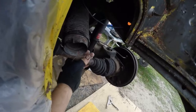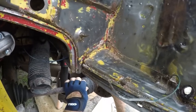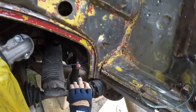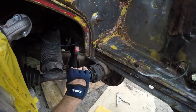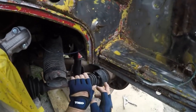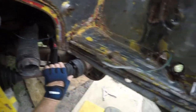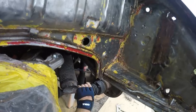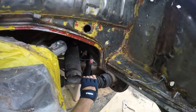Got a broke-off bolt in the CV axle — and this one looks broken too. Got one snapped off there, so I've got some extraction to do. I have more of these bolts so I can take these off, and when I slide this off of there that stud will still be on the piece stuck in the axle. I'll be removing that anyway, put it in the vise, take care of it, and replace the bolts. That shouldn't be too big of a deal — just put the vice grips on it once the CV axle is off.